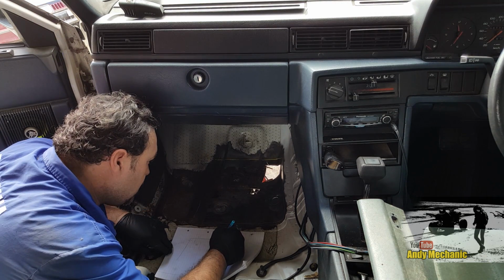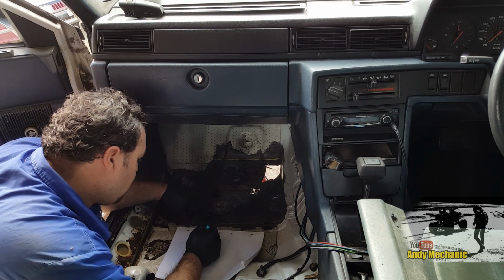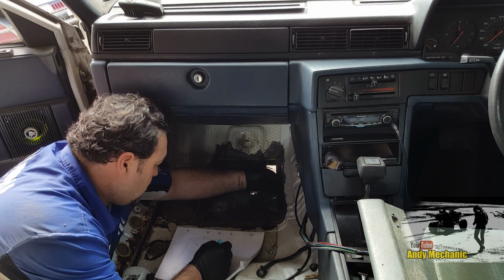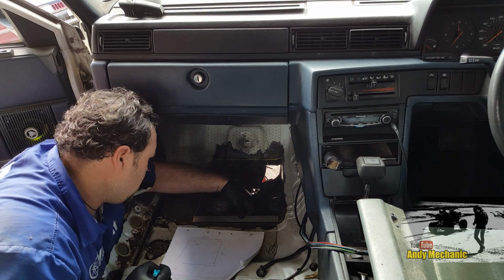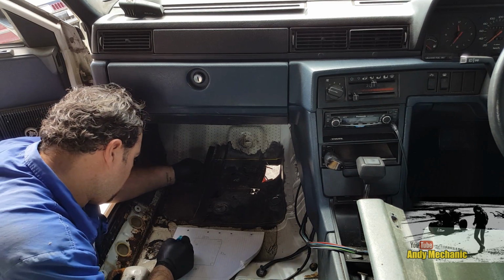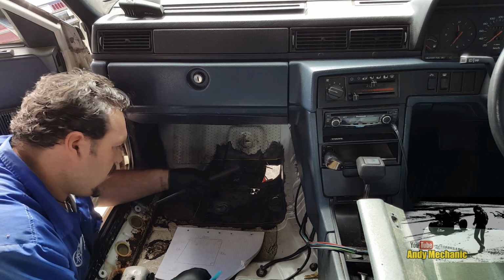I'm just thinking out loud about it, because it would actually dampen the voltage spikes, because arc welding is AC, then you get all these voltage spikes. And the computer ground, see, the computer's still grounded with the chassis, even if you disconnect the battery.